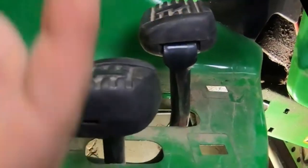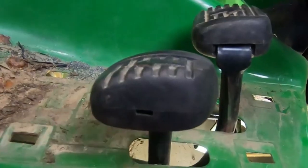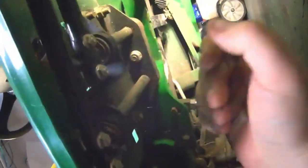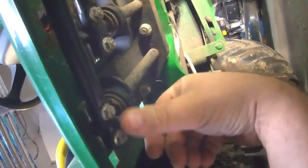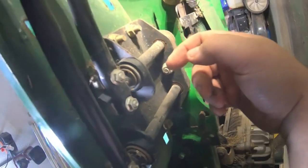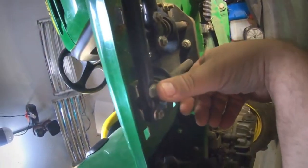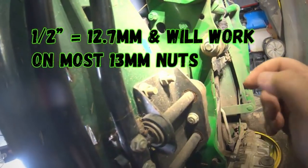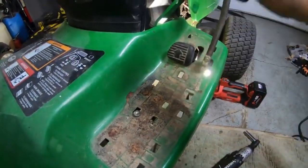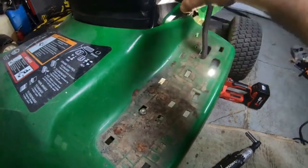On some mowers, you can just pull these little rubber pads off these foot pedals and then fish this up around and pull these out. On this one, it's almost impossible. So the best thing to do is just take these 10 millimeter bolts loose down here, and then take this entire foot control mechanism loose from the deck. These are 10 millimeter on the pedals themselves, and that's a 13 or half inch. Once you get all the nuts off these foot pedals, they'll just pull right out the top here and you can get them out of the way.